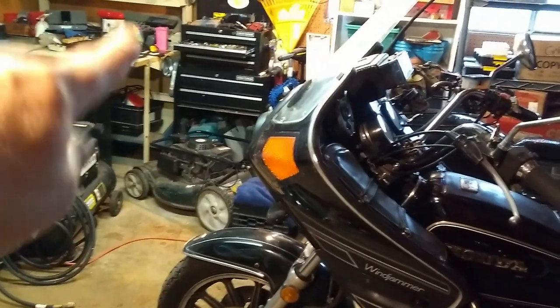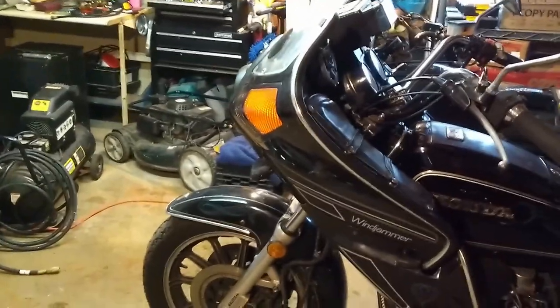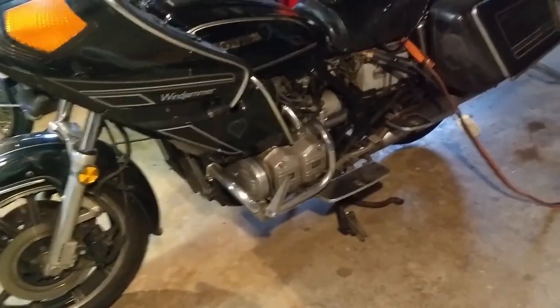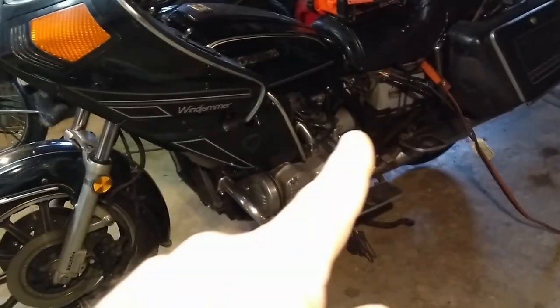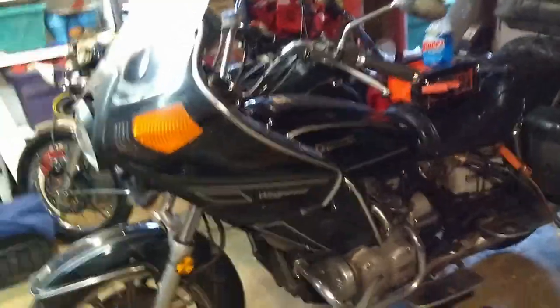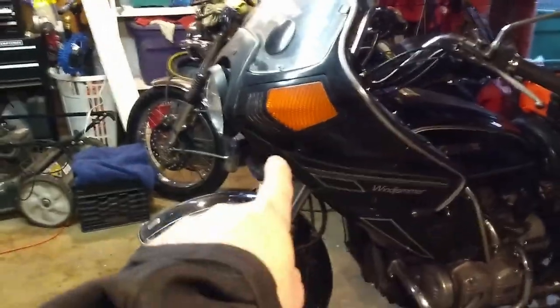I do have what I need to complete my workbench — I'm going to do an eight-foot bench for now with another eight feet I can expand to if needed. As far as this bike goes, one of the biggest problems with these GL 1100s is the alternator. If it's bad, you have to pull the engine and that isn't easy. What usually makes them go bad is owners accessorizing these Gold Wings heavily with lights and overtaxing the alternator. This one doesn't seem to have that — just some additional lights, the taillights, and the radio.